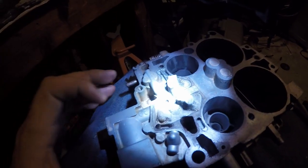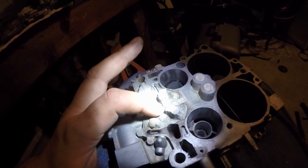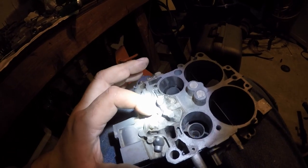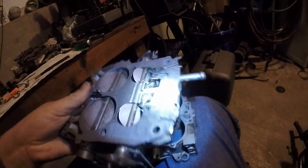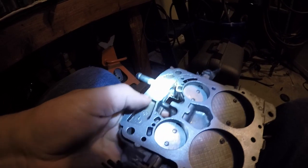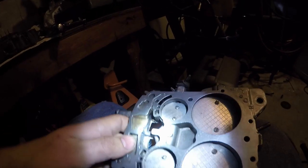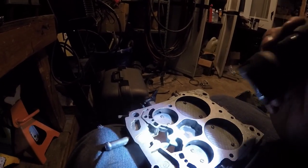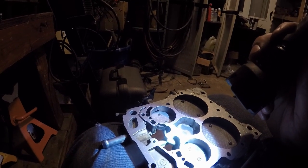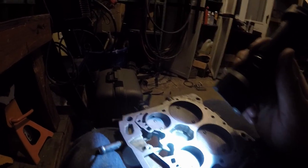If you look at the bottom of this thing, this hole right here is for the power piston — this is where the vacuum source comes from. The bottom of the carb is exposed to engine vacuum, so it sucks through this port and pulls that piston down. On a normally aspirated motor that works pretty good, but on a turbo engine when your turbo spools up it can actually pull vacuum — so it would think it's idling because there'd be high vacuum, and it would actually lean your carb out under boost, which would be awful.